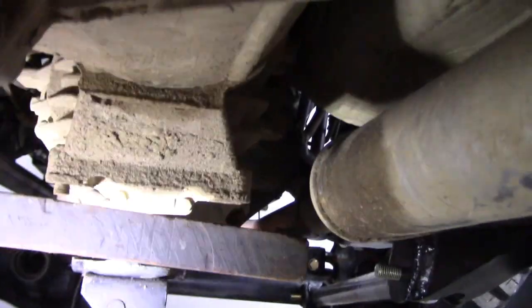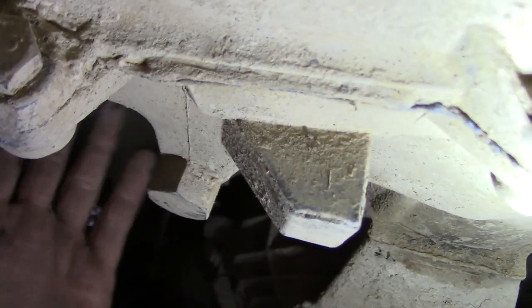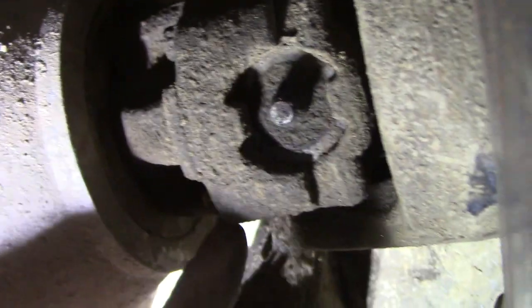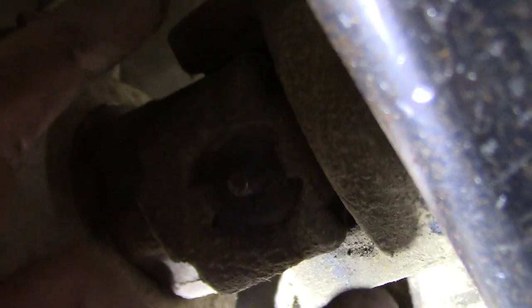These steps don't have to be in any particular order, but what I want to do next is go and take my drive shafts off. The front's already disconnected, but you need to take them both off — obviously, because they're both connected to the transfer case which we're trying to take out. Depending on what kind of transfer case you've got, drive shafts are going to come off differently, whether you've got a flange or a yoke. But pretty much the same concept — you should have to take about four bolts off and then the drive shaft should pull off. We've got to do that, otherwise we're not going to drop the transfer case.